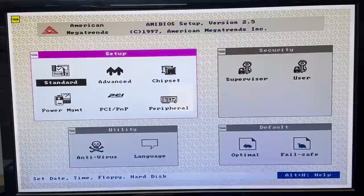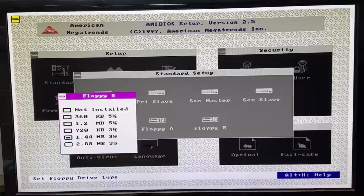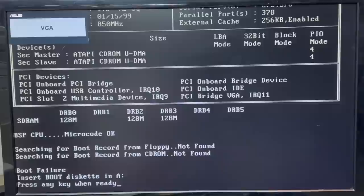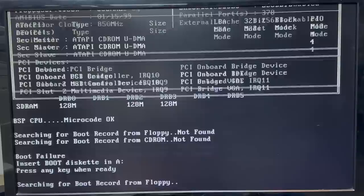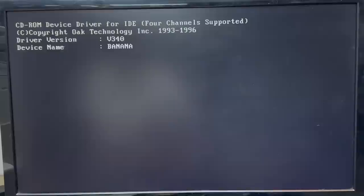What, this thing has WinBIOS 2? I'm finding a lot of machines with this BIOS on it. I don't have a mouse connected, so I'm just going to use the keyboard. Let's make sure the floppy drive got detected — that one's good. I'm guessing that's the B drive, let's go ahead and set that. The other drive should auto-detect, so let's go ahead and exit. Save changes and exit. Go ahead and insert a DOS boot disk. And it works. Got both CD drives.